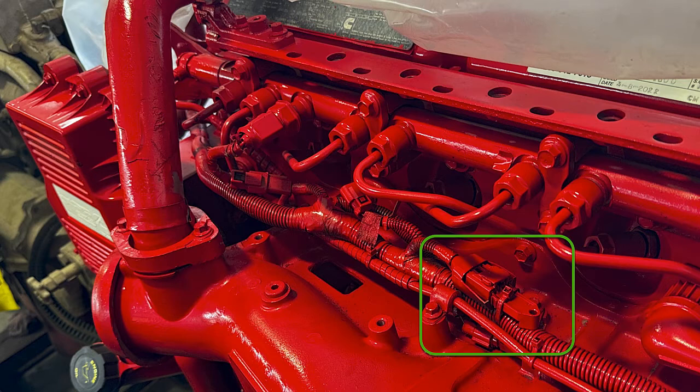The sensor is tied to the harness on top of the engine. Sometimes it's turned towards the injector or towards the head, and it's difficult to see. Sometimes the OEM runs their harness right along this harness and ties it to it — it's a bigger harness, so it's almost impossible to find unless you start cutting ties. This sensor does not have a fitting on it where it bolts into anything; the hole you see would be used on other engine models to bolt it to a bracket or fixture.